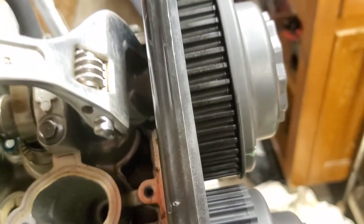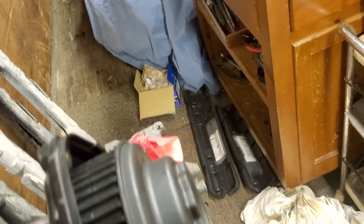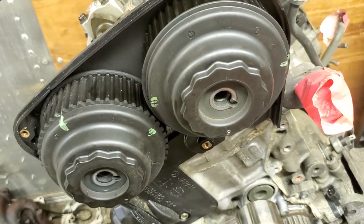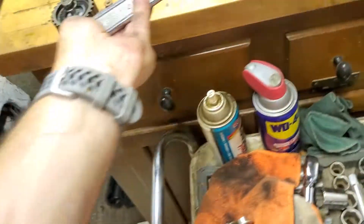As for what I'm locking onto — you've probably already seen this if you've got your head apart. Just fit that in there, hang on for dear life. And then you can hold that again when you go to torque these back on. I torque them to about 70-something pounds, and we're good to go.